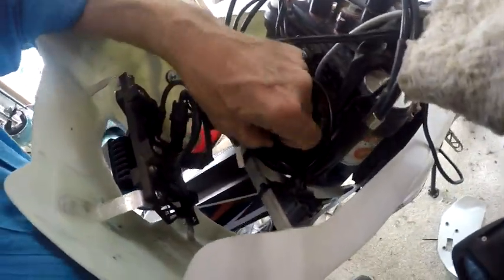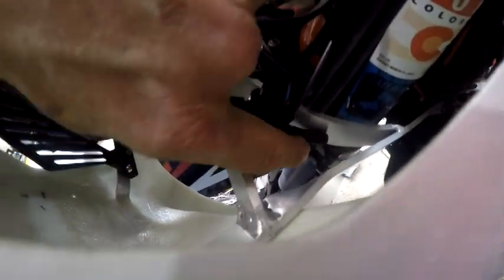But in the meantime, the air pressure sensor I tied right here. Normally it was on a plastic bracket that I screwed up cutting away on it. That's attached by the front fork on the left fork tube. And then I did put part of the stock cover back on this half and cut it down, so you can see that in there to mount this little connector bulkhead. And I went and tied the signal sensor directly to the metal fairing mount right there, by running a tie wrap through the little rubber part that's on it, and you just do a loop around there. So got that out of the way.